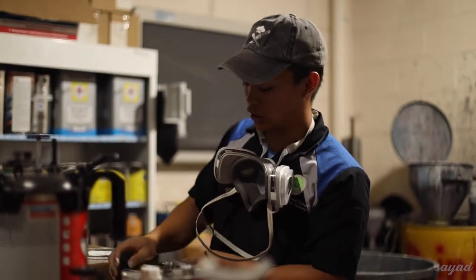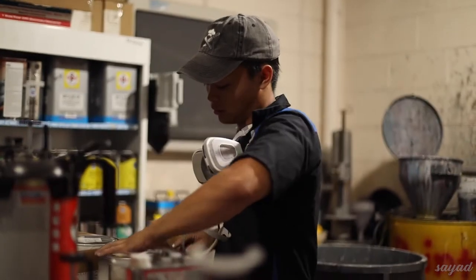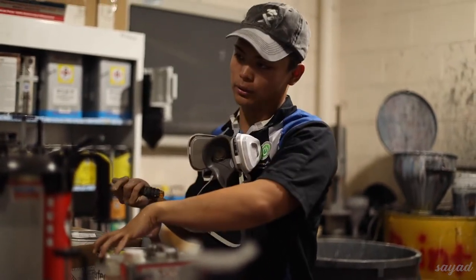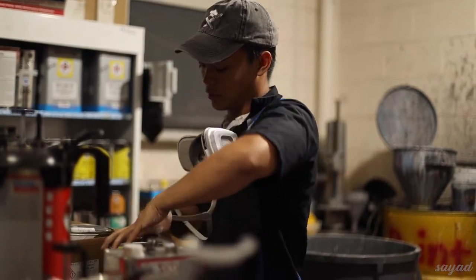We finished the base. Now we're doing pearl coat. You saw — we just laid white base coat. This is pearl that goes on top of the white. So this is actually a three-stage color — that means base first, separate pearl coat, and then clear coat. Because there's three layers. We'll check out this pearl.